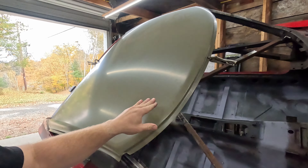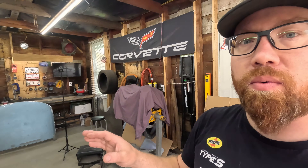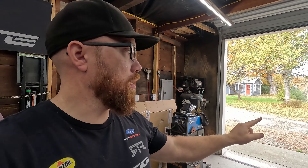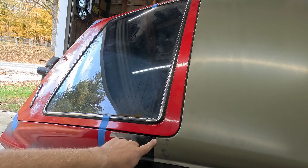The fitment looks very good. I did measurements from here to here to make sure the windshield gap is perfect and that looks spot on, so we're happy with that. I think I might grab my hatch and throw it on here just to make sure that it fits right — I don't want to get it all welded on and have a massive gap back here or something too tight. The fitment looks amazing — it fit right into my drip rails, the spacing on the front is good. I threw the hatch back on real quick just to check — the hinges aren't even bolted down, that's why we've got tape holding it on — but the gap back here is perfect. There's really not much work I'm gonna have to do to get this to fit, so let's get that popped back off and we'll be ready to weld it on.